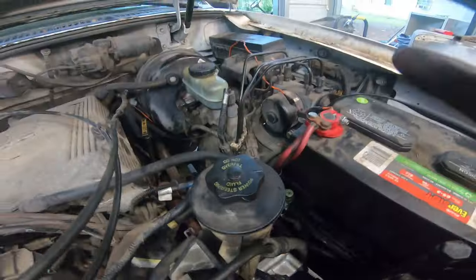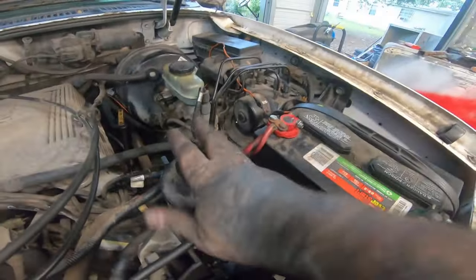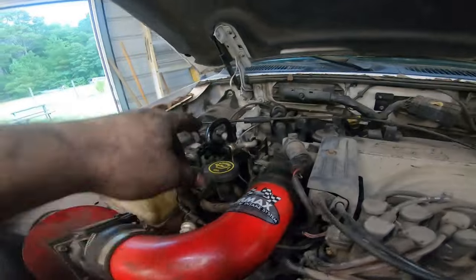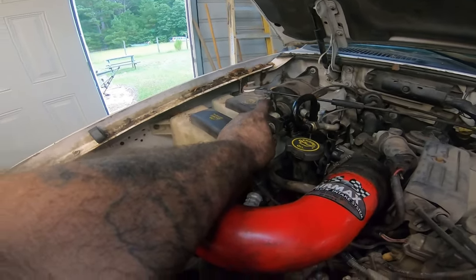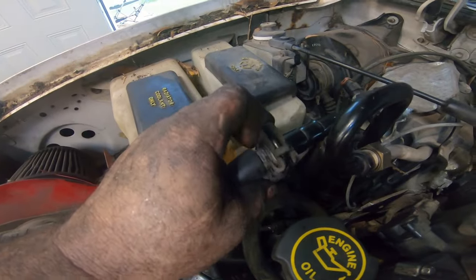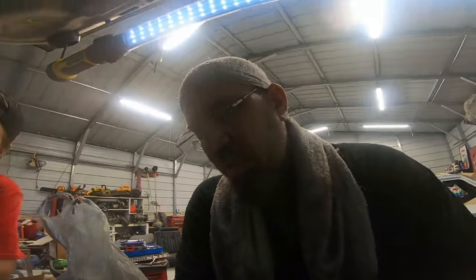run the bolts in. Yeah, I know we didn't show the whole process, but we got the battery back in, reservoir back in, new compressor in with oil, and the accumulator, I don't have the right tool to undo this piece right here. So we are just going to go ahead and leave it for now. That wasn't the problem. The problem was the compressor was leaking.